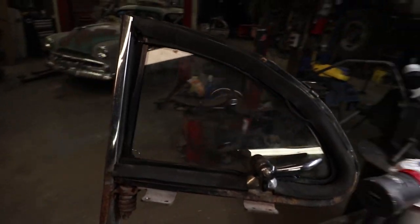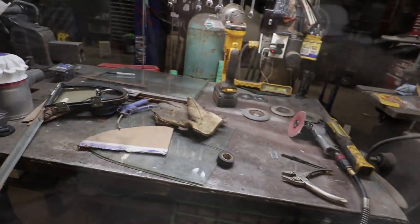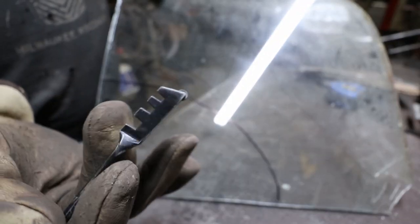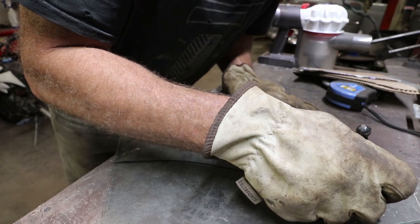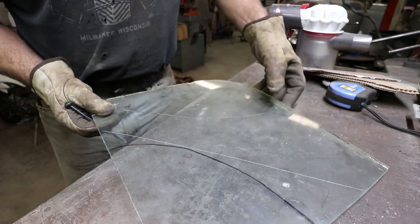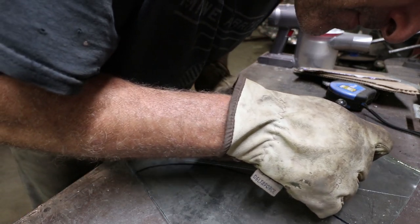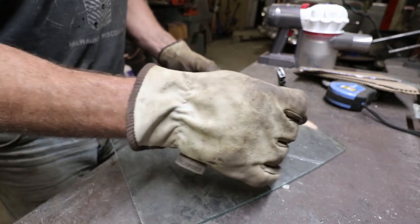It's in the car. I'm happy with it. One down, whole bunch to go. I'm going to do the other corner window, except this one there's a lot of curve in there. And again, I'm just using a regular glass cutter. So I'm just going to make a rough cut to get me started. Let's get rid of some excess glass here — do one score, and then you just trace that score. Let's give it a little tap because we don't care.